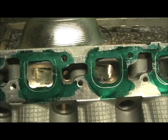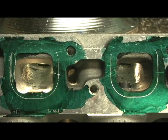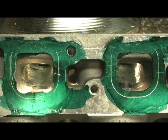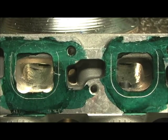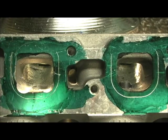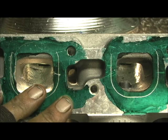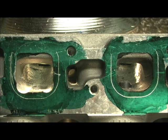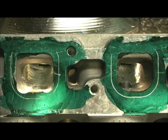I'm really falling in love with this head because it's so weird, so unusual with the half moon and the sun, and then this awesome exhaust and the chamber. I just wanted to show you the difference — you see what we're going for. I've saved the best for last: the combustion chamber. What a mess — you won't believe how bad a half-hemispherical combustion chamber can be. Just putting the Serdi machine on it and a radius cutter destroyed the wet flow. The combustion chamber is easily going to be 20 to 25 percent of the issue here, and it's all to do with shape and wet flow characteristics.